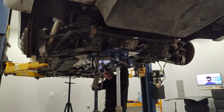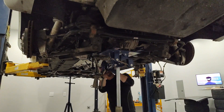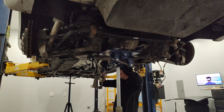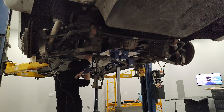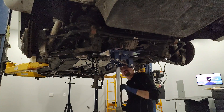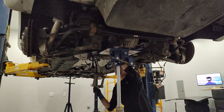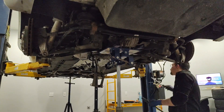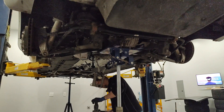At this point I'm also supporting the torque tube assembly — that thing is pretty heavy in its own right, probably 70 to 80 pounds — and removing all of the stuff that attaches it to the transaxle assembly for a nice controlled release. You don't want something like this falling. The transaxle assembly itself is probably 180 to 200 pounds, and the rear subframe with the brakes and everything is probably close to 400 pounds. You've got to really respect what this stuff is.